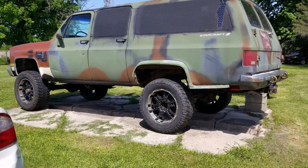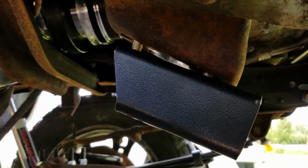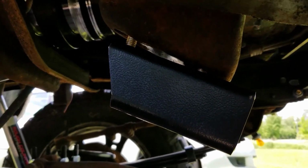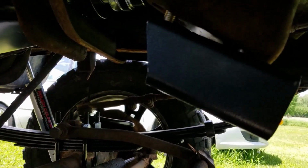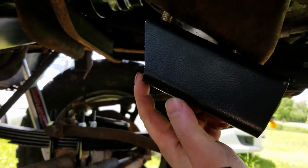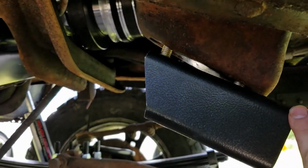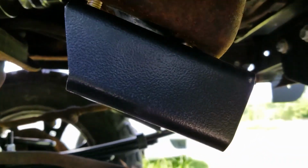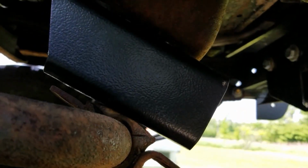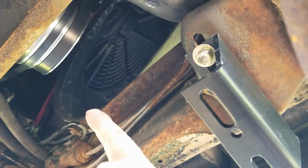Very big. It's good. Sway bar drop brackets. That's the way they will fit. Instructions show other way. So instructions show that this short edge go up top and this long part go on bottom. But sway bar not fit right that way. But this way, sway bar will line up much better. So the opening goes to the inside towards the engine. Is good.